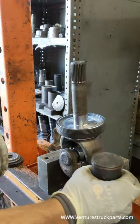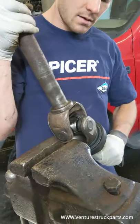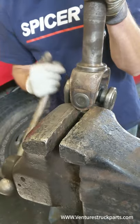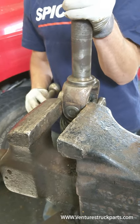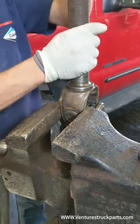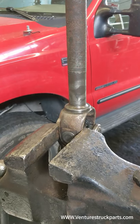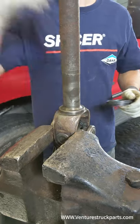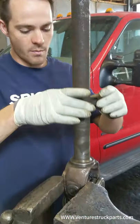Now that we've got the vacuum seal pressed on, we'll move over to the vise and show you how to put on the dust seal. We've got the shaft and I just clamp onto the inner yoke here to hold it. Make sure it's pretty tight in there so it's not going to fall. Get your dust seal, and make sure you've cleaned your shaft off a little bit because you've got to run this all the way down — you don't want to be getting dirt and grime all over it.